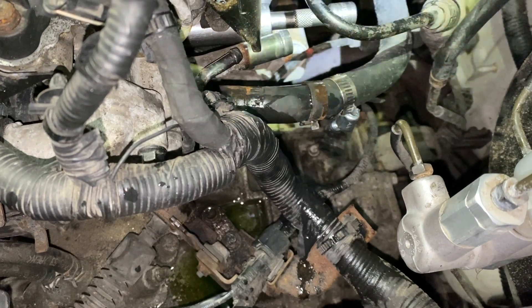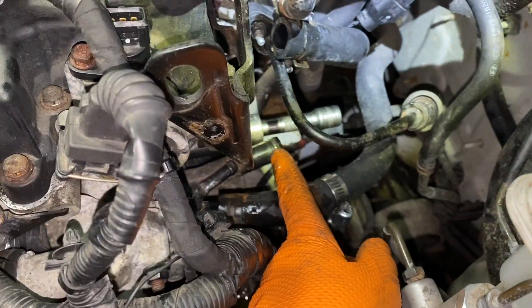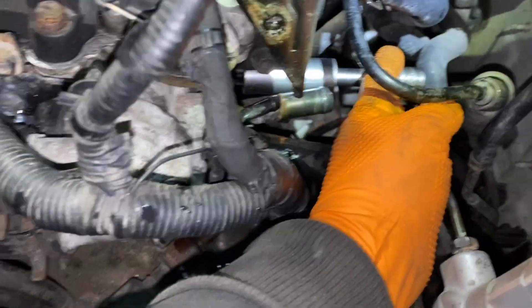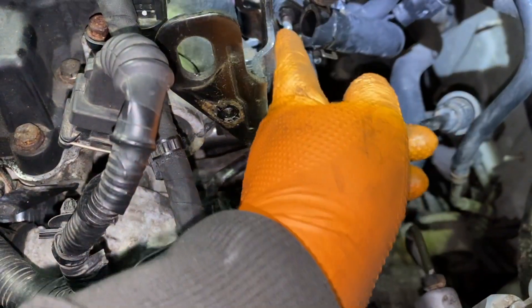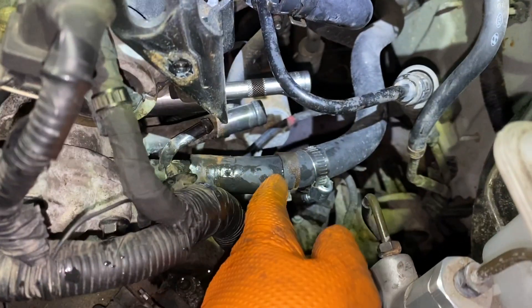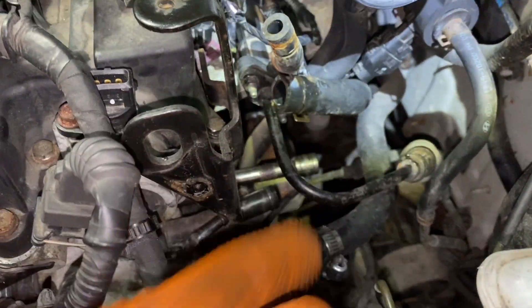What I did — you don't have to take this hose off, but this hose you would have to take off because it blocks it, and then you can get the socket in there — I have it on right now. You can see it right there, it slips right in, so you just take it off and install the other one. This is the coolant hose that goes there, and the little one — one of them goes up here and the other one goes here. With them in the way it's really hard to get to it, so you just got to take those two hoses off.